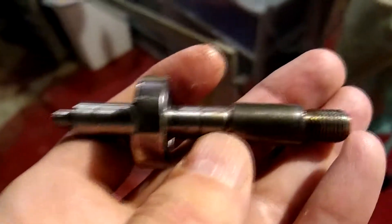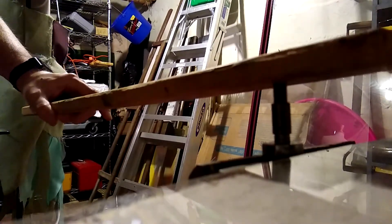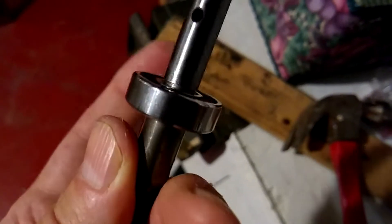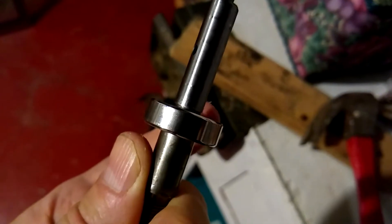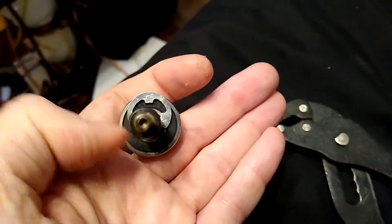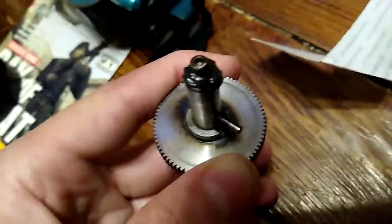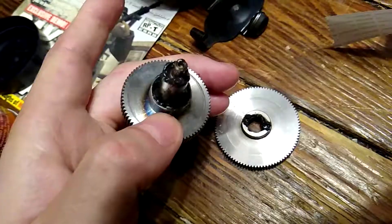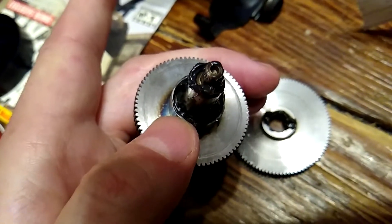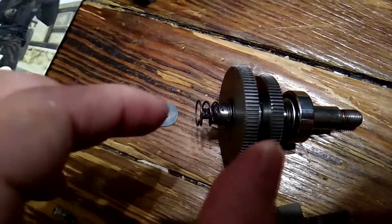Using a vise, a hammer, and the wood tapper, we're going to set the bearing. When you tap this bearing on, be sure it sits under that little groove where the e-clip sits - it's got to be fully under there. Push the e-clip back on using pliers, applying pressure on the middle. Then: spring, washer, lube up the small gear - flat side goes down. While holding the small gear down, set the little pin in there. Then the collar. Put some grease between the collar and the pins because the big gear goes on next and its grooves go down into the collar area. Then washer, another spring. The washer and gold collar go on next - there's not much room, so we're going to assemble that in the case.